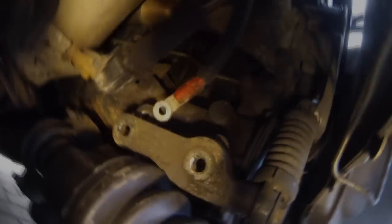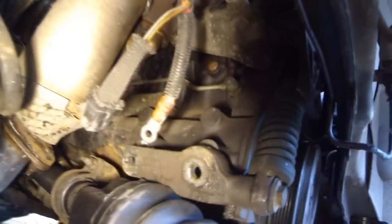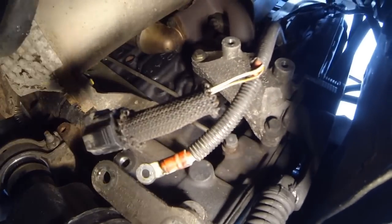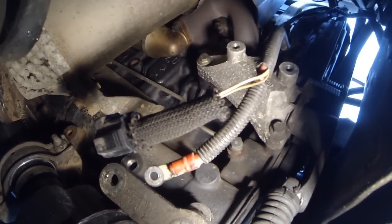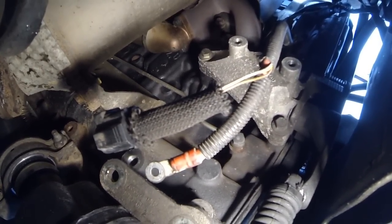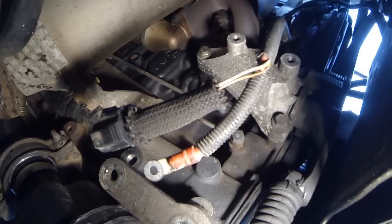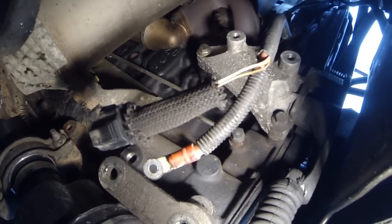Right, well, I don't know how much, if anything, of this you can see, but there's a big aluminium, how's that? Can you see it? Big aluminium bracket there, and it's got 3 13mm bolts going through it, and apparently those are the bolts which we've got to undo, which slacken off, so that you can remove the adjuster. We have to do that because we need to slide the belt behind the back of the adjuster so that we can get it off.